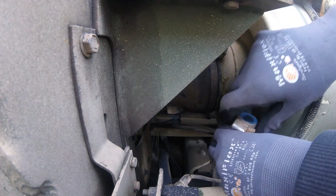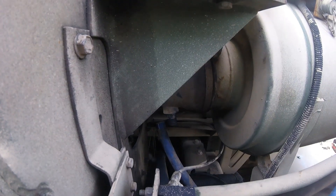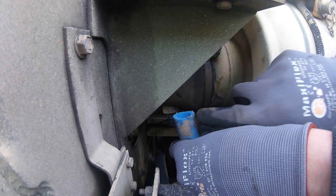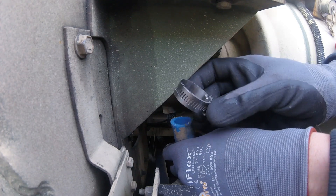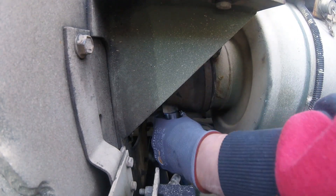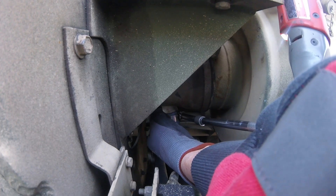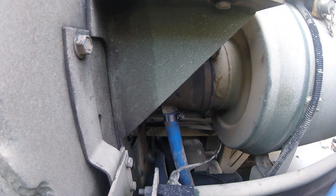It's dry up here. Okay, clean the hose out. I cut the end off of it because if you're using regular hose clamps, it absolutely just destroys silicone hoses. My suggestion on these trucks is to change out all your hose clamps to breeze clamps. You won't have hoses getting torn up because you tighten them down too much — you can set them to the correct pressure. Overall, they just work a lot better. You don't need to put them on gorilla tight.